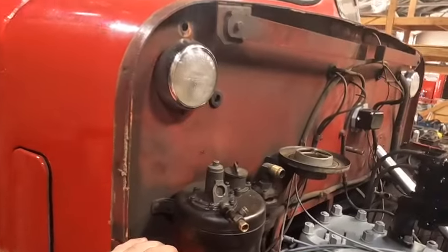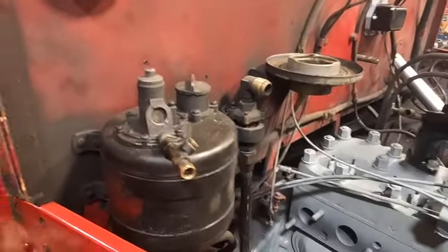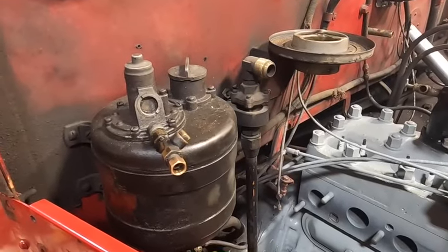I also wanted to talk about a thing on some of these trucks. I've seen on the forums people asking what this is for. It's called an upper cylinder lubricator, found on some older trucks from the 1940s and 50s. It's a device on the engine that's supposed to suck oil out of a container on the firewall, go into the intake, and provide some upper cylinder lubrication. If you have an early fire engine, truck, or maybe a commercial truck, they might have this too.